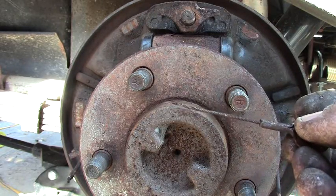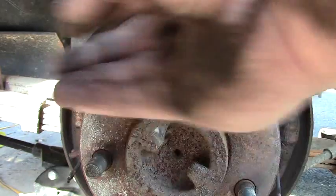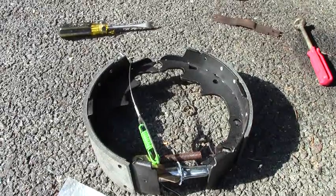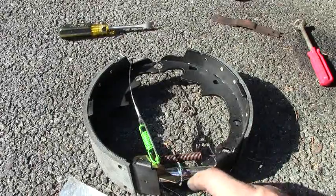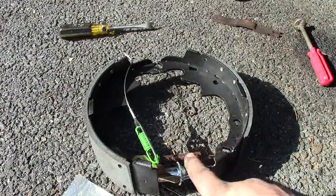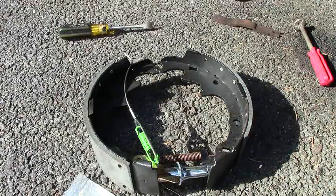Now here's a good reason why I tell you to get new adjuster parts — see, this one broke. All right guys, one more time for you. Here's your adjuster, adjusting arm, spring on there, rivet, adjuster link, spring. Then we'll fold it off and push it on.